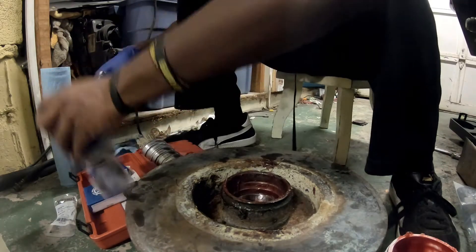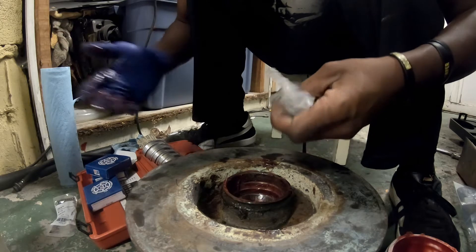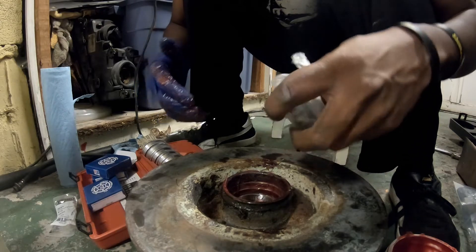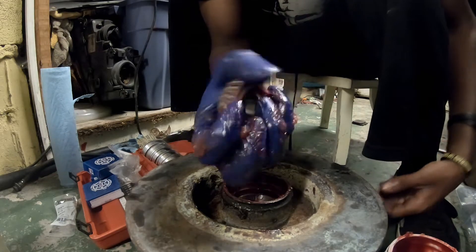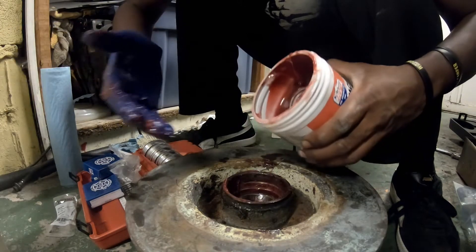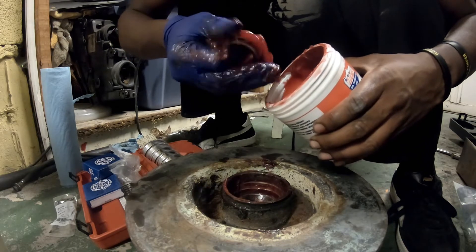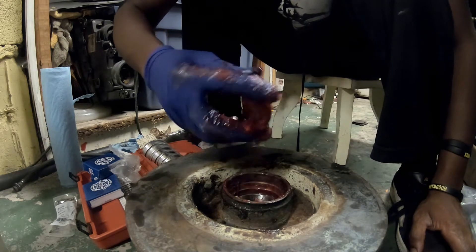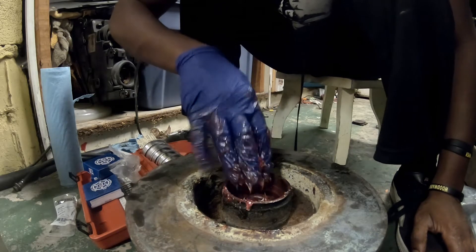Your rear wheel bearing — that's your larger one. I'm gonna try to open this with one hand. Take this — hand's covered in grease — just throw the whole thing on in there, get it absolutely covered. The race is tapered as you'll notice, and so is this wheel bearing — you gotta make them match up. Nice and simple. It's not gonna sit very flat right now, but just you wait.